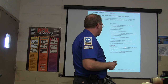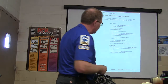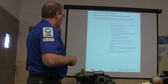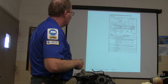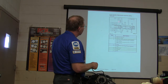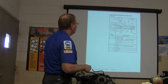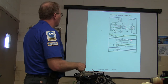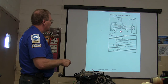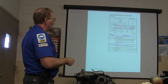If the EPC fails shorted, which is zero EPC pressure, you'll have trouble in third and fifth gear and it'll slip in second and fourth with high input torque on transmissions like the 4R55E. If it fails open, you get maximum EPC pressure, and it can also set a false vehicle speed sensor code. The electrical connector on your electronic pressure control solenoid has exhaust to the sump on number two. Low current command is maximum pressure; high current command is minimum pressure.